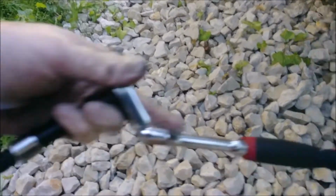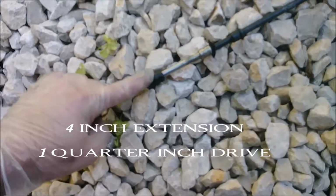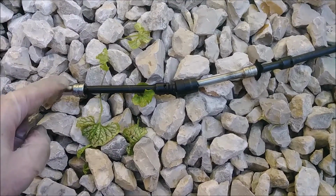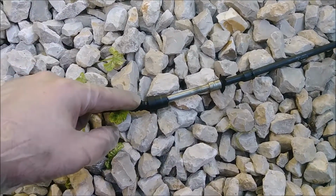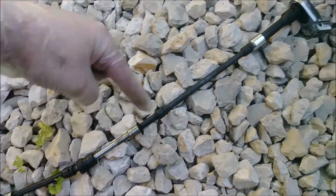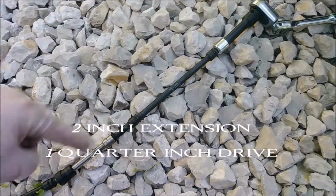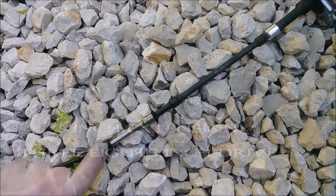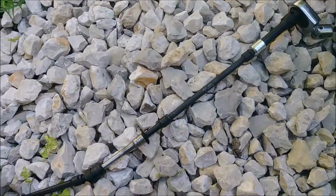I'm loosening it. And here's what your Voltron Mega Zord looking thing looks like. So you can take this, the swivel socket, all at once, and then while you're looking with your left, with your knees on that, and you see the bolt, you're gonna just press with your hand, your right hand's gonna slither in there, push this on. When that's secured, you're gonna have to hold it still with your left, or you might still have your right down there if you have this nearby. Grab whichever hand you have free, jam this down in here. Once this and all this makes contact here, you're gonna do what I just showed you. Hold with your right hand that's already down here, apply forward pressure on this bolt, this inverted 8E Torx, and then just bust this thing loose with this end. That's how you do it.